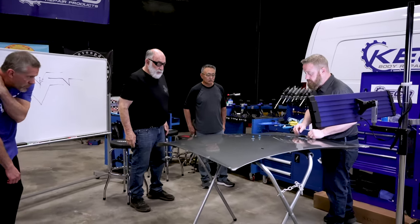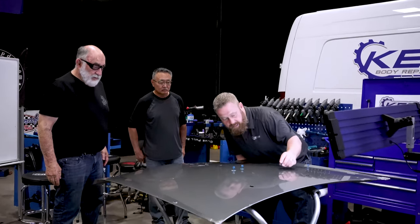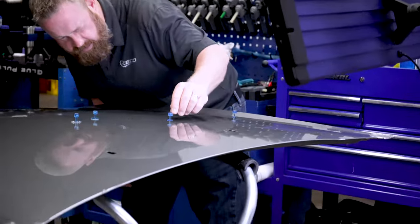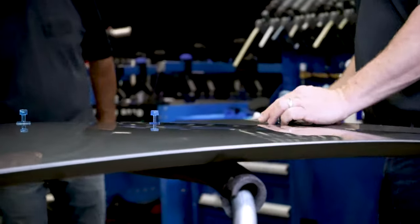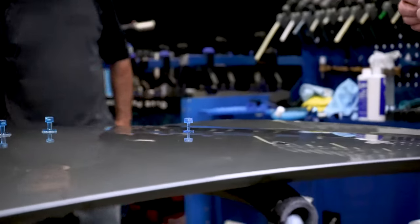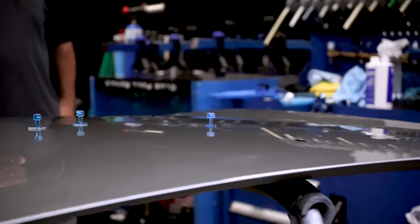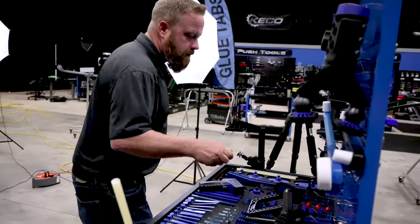On aluminum, because it is a more stubborn, rigid metal to move, I'm going to upsize my tab. So I'm going to go more like that. More or less 90% coverage of that distortion. I can see just a little tiny flicker of distortion on either side. Now the reason is, again, back to that slide, what's our secret? Surface area. So power gets us there.